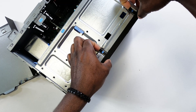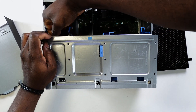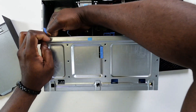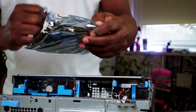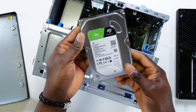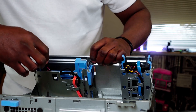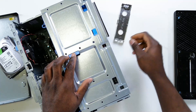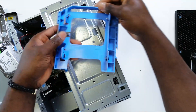Installing the SSD theoretically should not take time, except that for one funny reason it took quite an effort to unplug the SATA cable — the thing was more or less stuck onto the old drive and I had to literally fight with it to get it out. The HDD drive bay was also kind of strange. I'm used to older Optiplex machines like the 7010, 7020, and 3020, where getting the HDD out is straightforward. On this machine, I needed to gently remove the front panel first, which was a long process, but I did get it fixed.